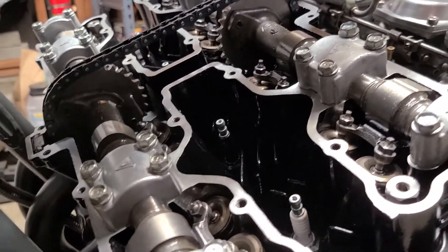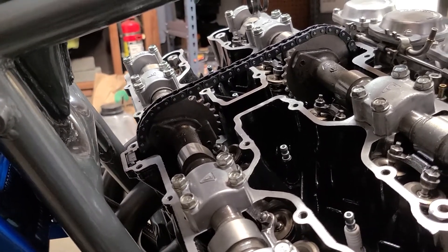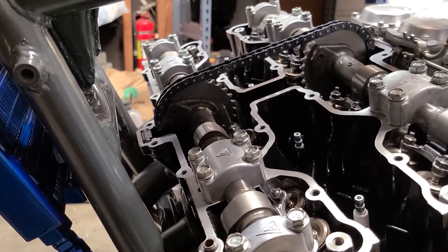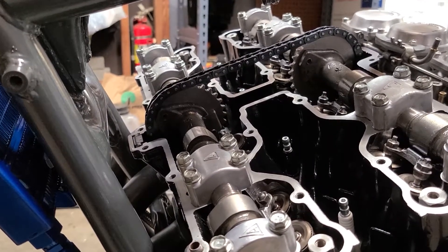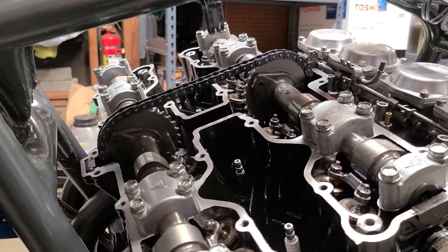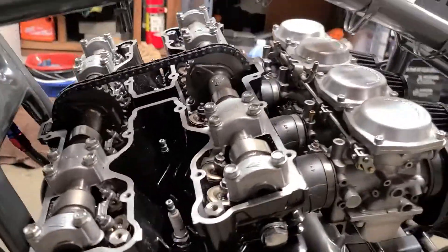My goal is to make these a tight five and a loose four, because they can be adjusted between three and five. Since the rocker arms, cams, and everything in here are pretty much new, I don't want to get them too tight. A noisy GS is a good running GS — if it's making some noise, that's okay. I'd rather have a loose valve than a tight one, because if they're tight you're going to end up burning a valve or bending it, and something bad is going to happen and you'll have to take it all back apart.